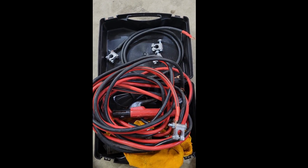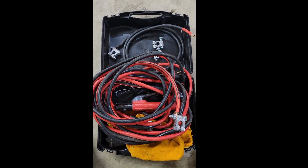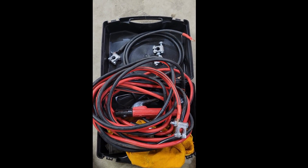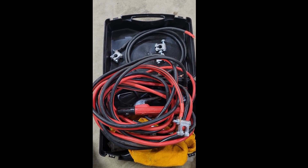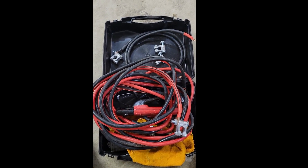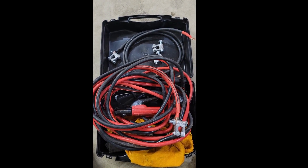That 24 volts is what's going to allow you to actually get some penetration while welding. Maybe not as nice as some of the fancy kits you can buy for a few hundred dollars, but I have less than $80 into this whole box. It fits in a case you can throw behind the seat, and as long as you've got a second battery on your rig or a buddy with you, you can weld on the trail.